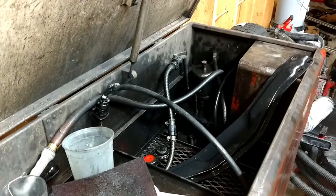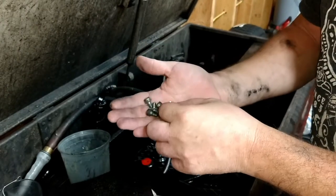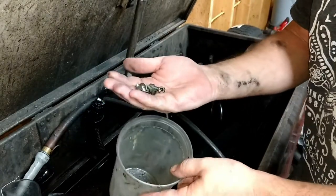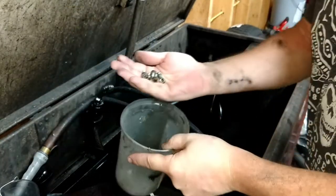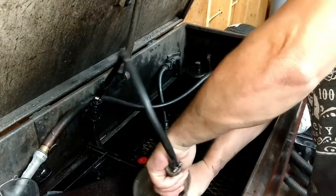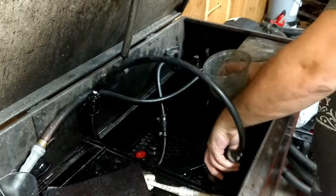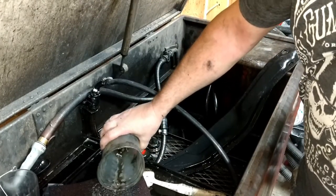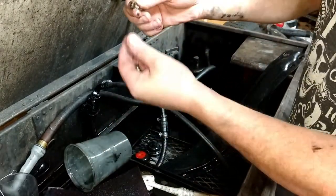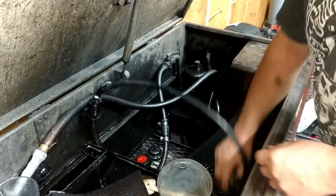As far as the bolts go, some of the bolts have the cadmium — or chromate — that gold coating on them, and I like that, it looks really good. These are the bolts that hold on the dust shields — you're never going to see these again, but I like to just put them in the parts washer. If you just hit the parts washer in a cup for a minute and pour it out, it cleans them up really nice. I'm going to put them in there and clean them up because I like to get them that golden color again.